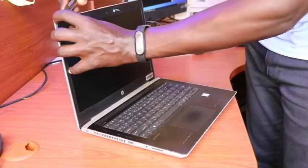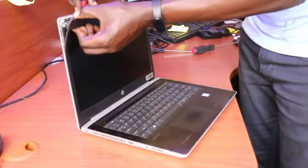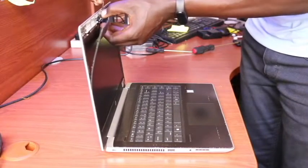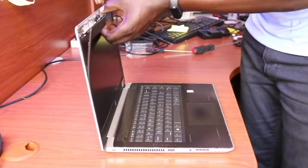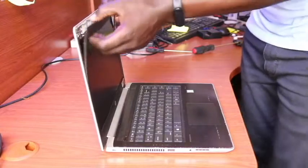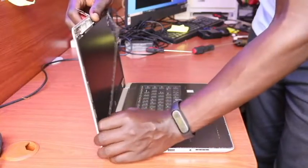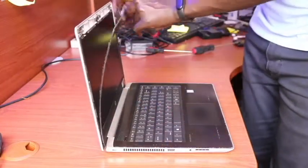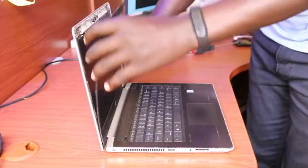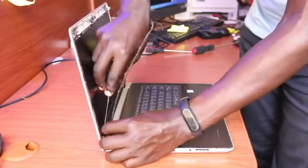With our presser tool, we gently unlock the locks that are attaching the screen. There is a sticky glue attached to it, and gently we are removing — or rather unlocking — the screen bezel, the frame, and the screen itself. We have to do this gently on all sides so that we don't break any attachment. There is a sticky glue that you have to remove gently.